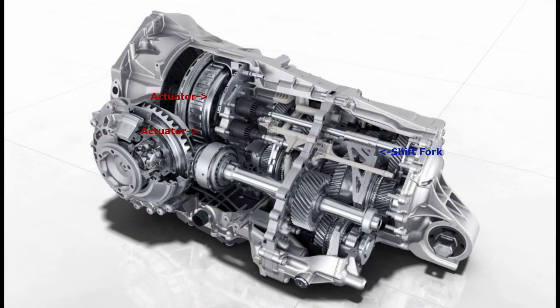The last theory is that they actually have hydraulic actuators on each fork, meaning each of these shift forks is independently controlled by a hydraulic actuator. This is actually very similar to what you would see in the Porsche PDK gearbox — there's actually a little hydraulic cylinder for each shift fork. In Porsche's case they have an individual tube for each one of the shift forks, but there are different means we could theorize for having a lower number of those tubes.